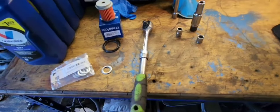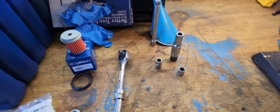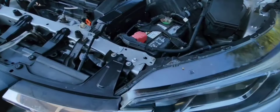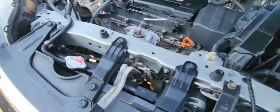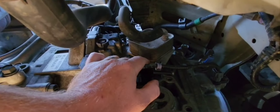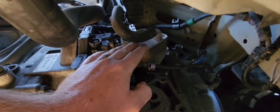You'll also need a 10mm and a 12mm. I'm also going to need a 10mm deep socket just to get my battery tray out, because I'm going to be taking the battery tray out so I can actually film how to get that cooler off — your filter is actually going to be located behind it. This is going to be your transmission cooler, and the filter and o-rings are going to be placed behind this.